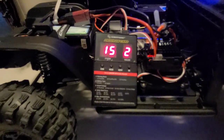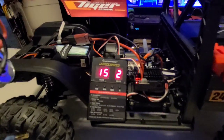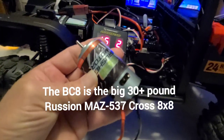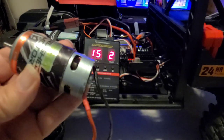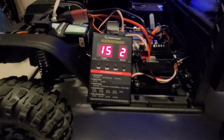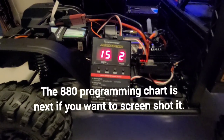Also, on my last video I made a mistake — I said the BC8 motors were 35 turn, but they're not, they're 38 turn. It doesn't make a whole lot of difference, but compared to a 25 turn motor — a three pole motor — it's going to make a difference. You'll get to see it drive here in a minute.